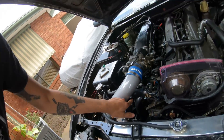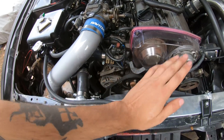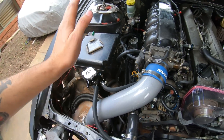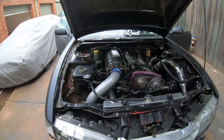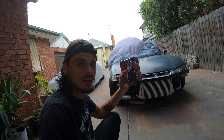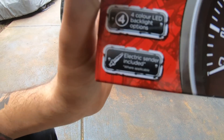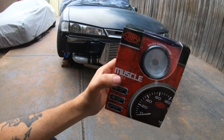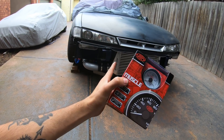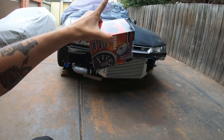I just need to quickly run to the shop and grab a sensor — I had to buy another water temp gauge. I don't want to, but once we put that in, put the sensor in, we're ready to fill up the coolant — not water, chuck in some coolant into the swirl pot as well. Start the car, see how it all goes, and then we get to go drifting next Monday. I cannot believe I just paid $74 for a water temp gauge just so I could use the water temp sensor right here. Already got a water temp gauge, but I guess I'll be using this one now. I'll be doing a video of installing gauges maybe this Thursday — the oil pressure, the oil temp, and water temp gauge on Thursday's video.